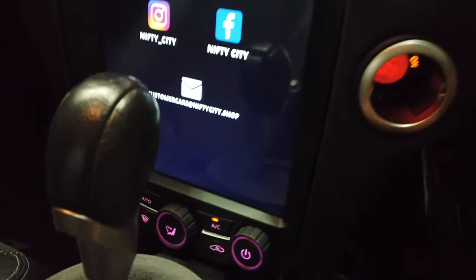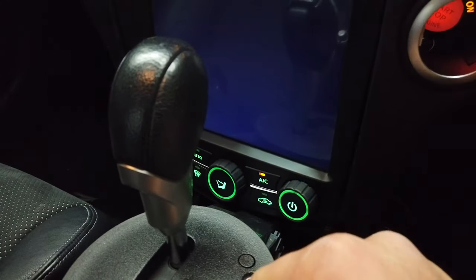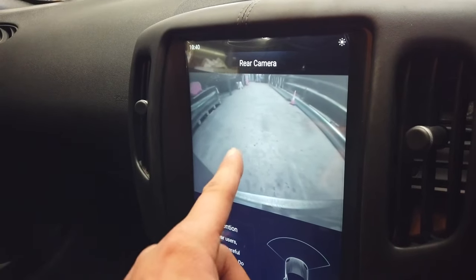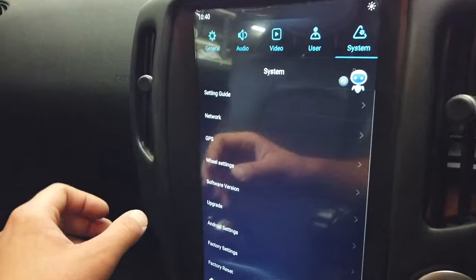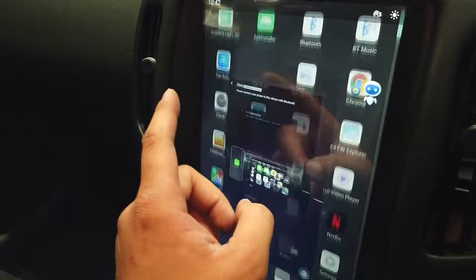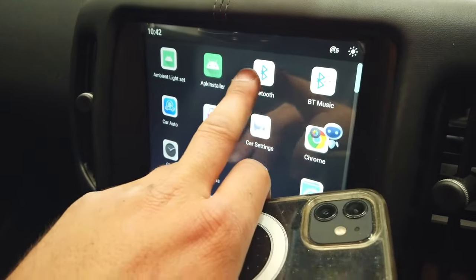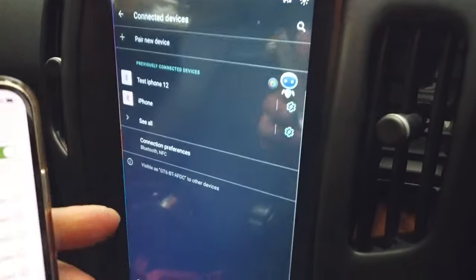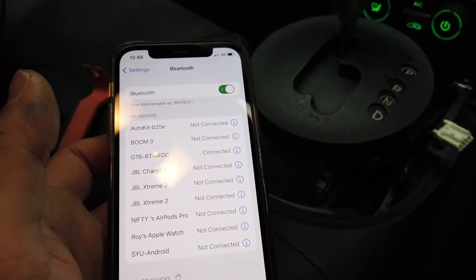Turn the car on so you can try the AC controls — make sure these light up. Try volume, air con, reverse camera — try everything before you commit to installing the Tesla unit onto the dash. If you're missing your guidelines just go to Settings, System, Setting Guide, and then Reverse Guideline. To connect CarPlay you need to open up Car Auto and open up Bluetooth on your phone. If you don't see the connection there, go to the Bluetooth app and hit the connections list and it should come up. Tap that, pair and allow, and then wait a few moments.